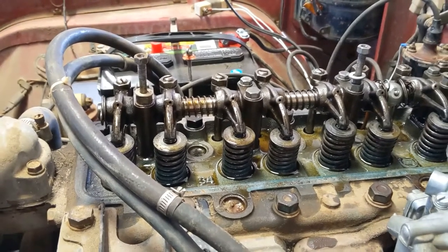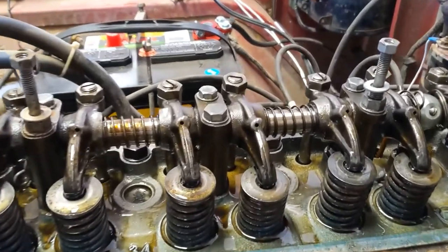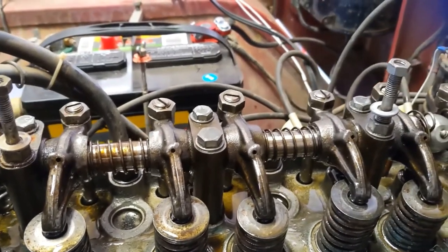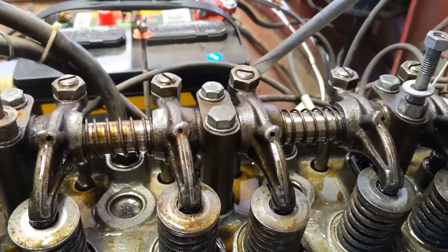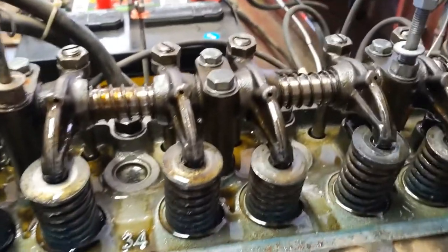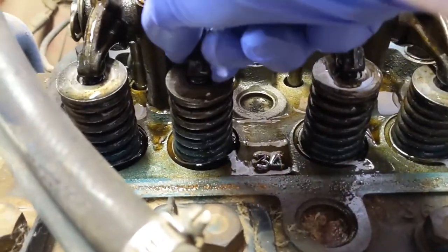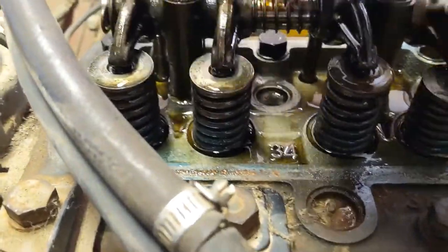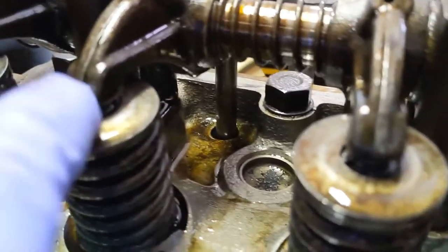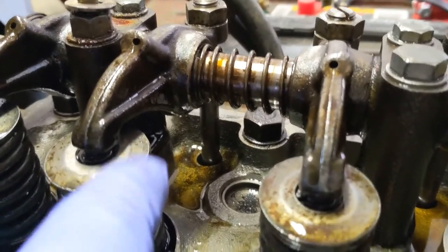This episode is going to be about adjusting the valves. On older Land Cruisers like this, there are mechanical adjustments to valve lash, which are these screws right here. The way it works is you loosen the lock nut right here, then get the valve all the way up so it's a little bit loose — like that one. You can hear it, and then measure the clearance between the top of the valve, which is inside this spring, and the valve lifter and the rocker arm, which is right there.